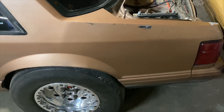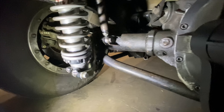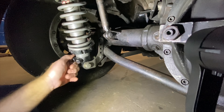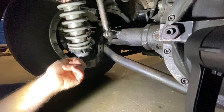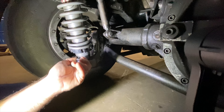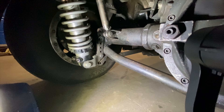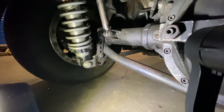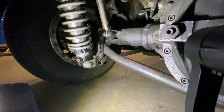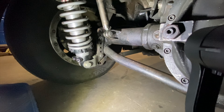If you're not scared to cut up your car, it's worth it. What I'm doing up under here right now is loosening the QA1 shocks. In a no-prep world, or any track that is really bumpy, if the shocks are too tight the tire will basketball — instead of the suspension working, the tire will start bouncing, especially on a radial. It'll upset the car, it'll spin, and the shock's not moving. I think in a no-prep world shocks need to be looser, and with the shocks looser it allows the shock to actually work and not the tire to bounce as much.